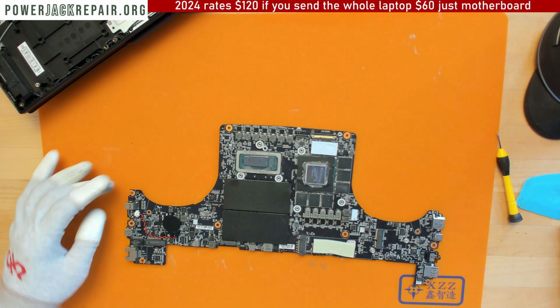All right, so you see that plastic, the one I was talking about, is right here. This is the plastic connector for the CMOS battery, and it's too close to this pad right here, so in the factory you don't heat up this area too much because this whole plastic piece is going to fall apart. Maybe they put the connector first and then they put this in, but I think that's the reason why nothing got soldered properly. Oh, wow, the board is so thick, take a look at that, it's one of the thicker boards.